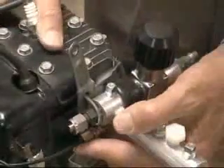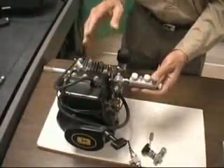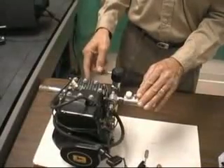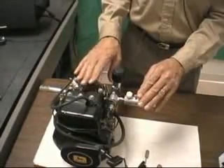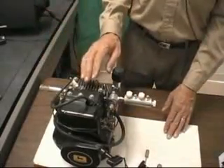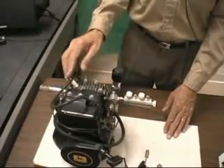You can also do your own timing on an engine such as this one by removing the flywheel, removing the key that sets it for the gasoline timing, and then relocating that key for a later ignition. You can use a half-key or some fraction thereof for the offset, or you can mill a new slot for your new hydrogen timing setting. It's a quick conversion, though it is internal to the engine.